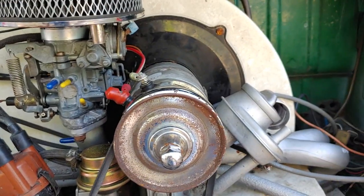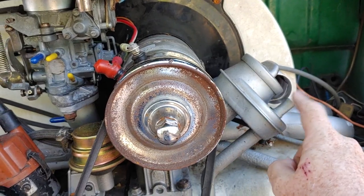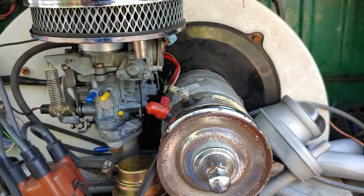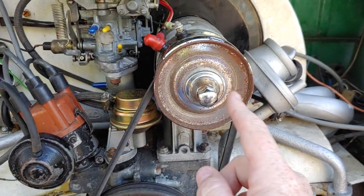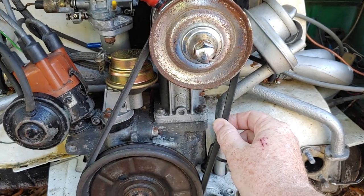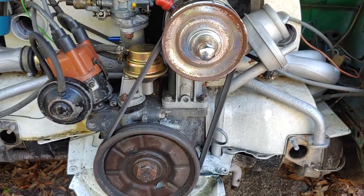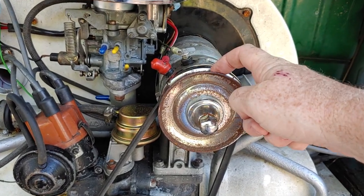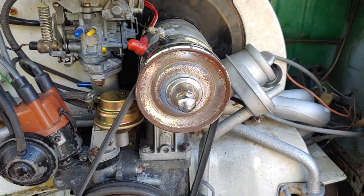So we need to get an exhaust system on it and button up the vacuum leak. I'm going to get a piece of hose and put it from the oil filler to the bottom of the carburetor. Hopefully it'll smooth this out a little bit. I'm still going to look at how to adjust the belt. Comment below if you think this belt's still good, or once they start wobbling like that, should they be replaced? I'm pretty sure it just needs a couple shims up here. It'll probably straighten that right out.